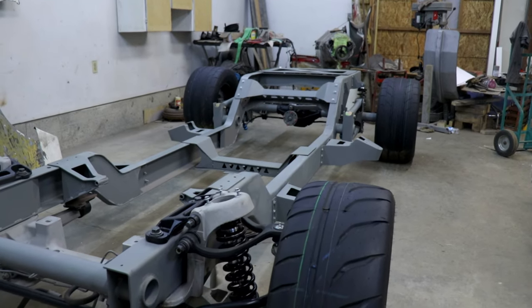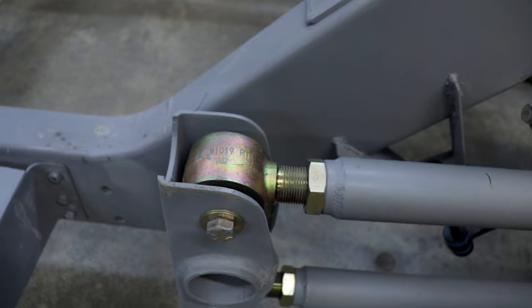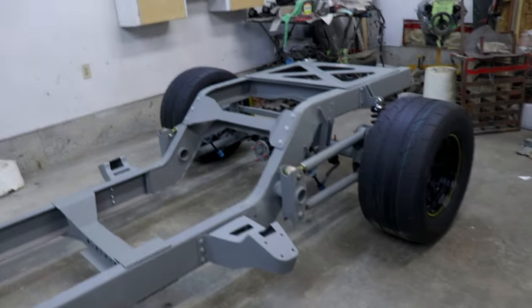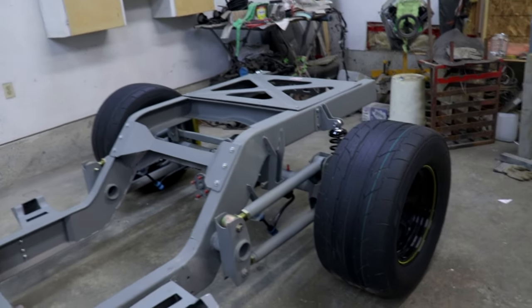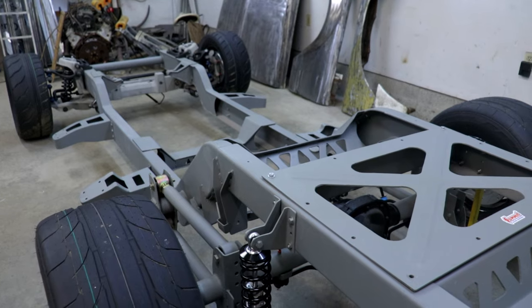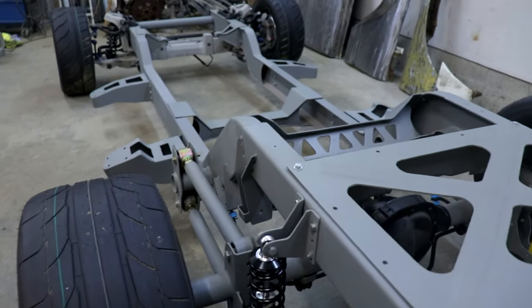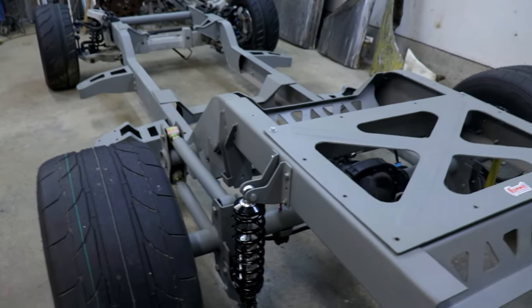Stuff like that — it's things you don't really notice until you do it. You're not going to be able to get the design perfect right off the get-go, but that's what makes it fun. Surprisingly, the rear of the chassis is the original design — I never touched that once. With the custom four-link setup I made, it was pretty lenient on what I could do. The rear suspension, the shock towers, and the mounts were kind of inspired by the QA1 kit I installed on my 72, but instead of trailing arms I went with a four-link. After I was happy with my frame rail design, I had to figure out how to bolt it to the ground so I could make my crossmembers, mounts, and all that.